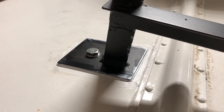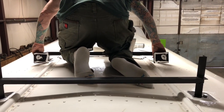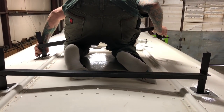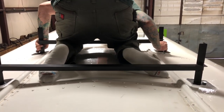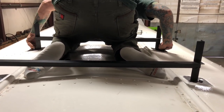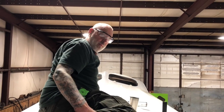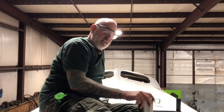You can see how it just follows the profile of the roof. He's got the Sikaflex on both sides, then we drop the bolts down into the holes - hopefully without getting goop all over. Then I crawl down inside and put the washers and nuts on.